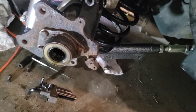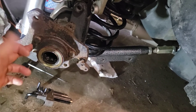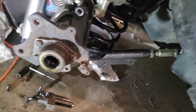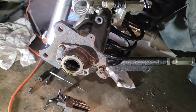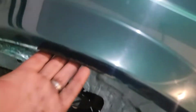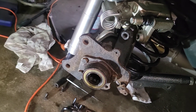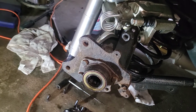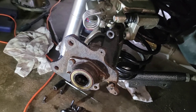I've got the brackets flipped over — let me show you what we did there. This bracket is normally on this side of the flange. You cut a place out, flip it to the other side, and that moves the brake caliper in three quarters of an inch. That lets you use stock Fox body length axles, which I'm hoping will give me enough space up here for the tire. I'm watching drag week so not filming too much.